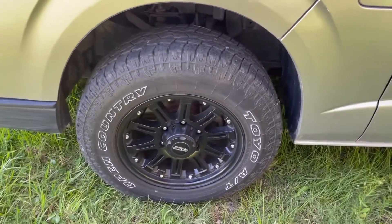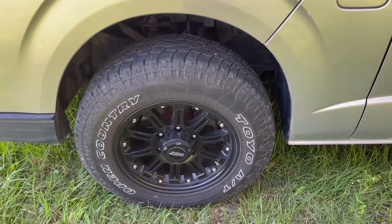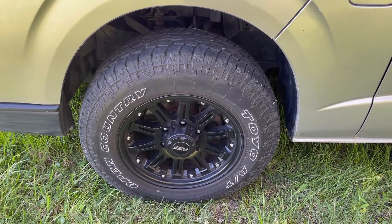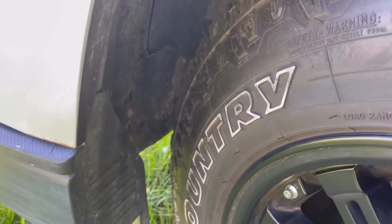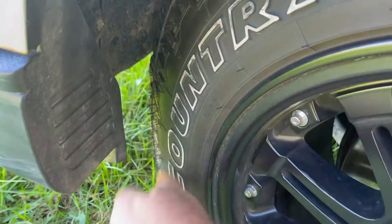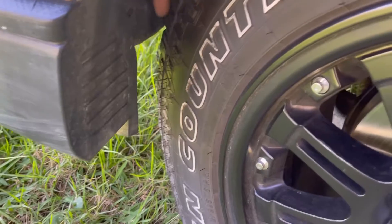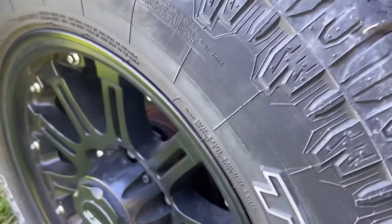This is going to hit in there a bit more — you'll get clearance at the back of the wheel but you'll still rub that outside edge on the front. This only happens on full lock, usually when going backwards. I've got the wheel turned in now — not full lock — and I can just get my fingers in there. At this edge, when turned further, the tire edge comes within a couple of millimetres of that panel. That's with plus 25 offset.